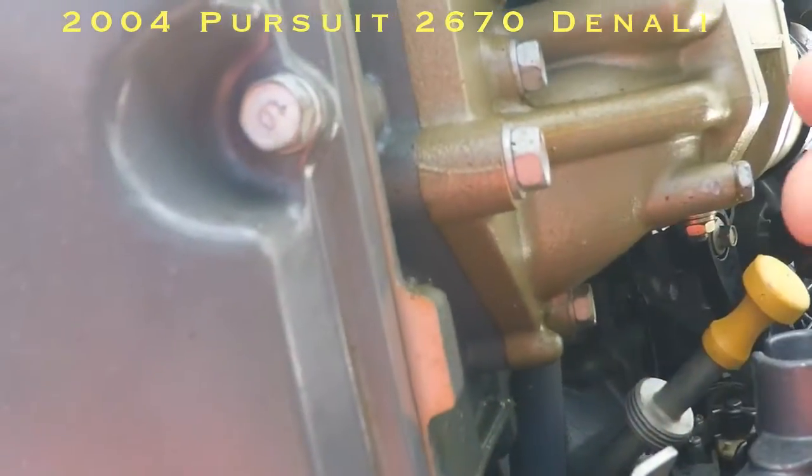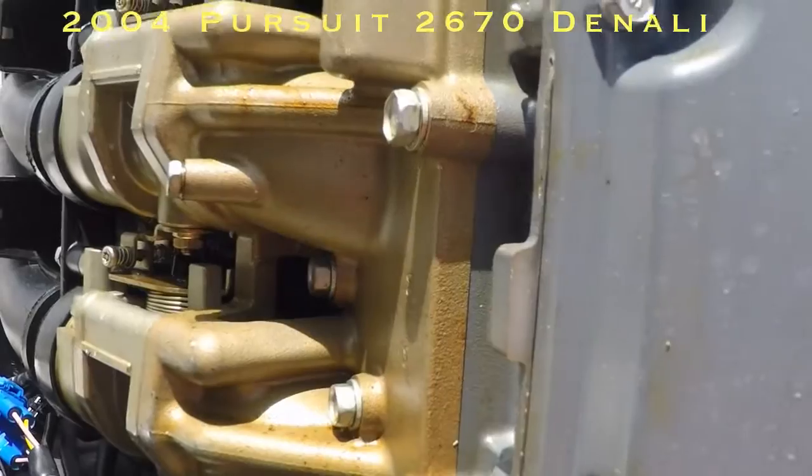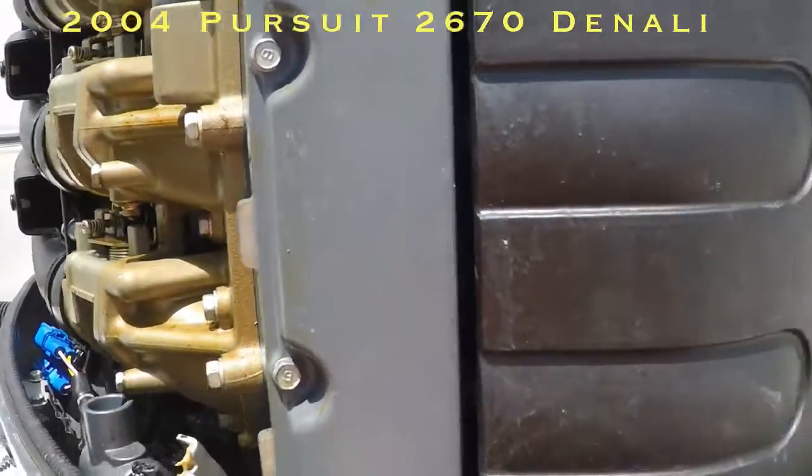You can even see this little film here of like a greasy substance. That's from when they do the 100-hour services — they lube and take care of the motor, and that helps keep it in good condition. Whoever's been working on this and maintaining it has done a great job.